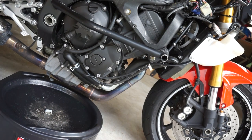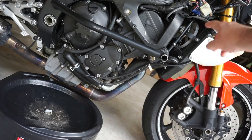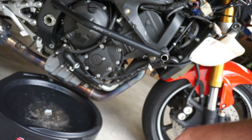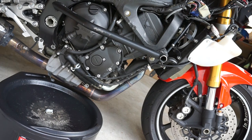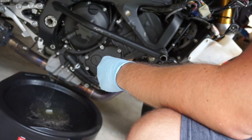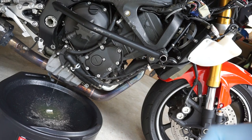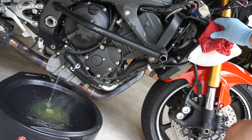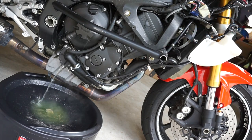At this point we just turned the bike off. Keep in mind you can't unscrew anything right now because everything — the radiator cap and the drain nut — are going to be hot as hell. Let your bike cool off for a minute, then we'll take the screw out and the radiator cap off and let all that distilled water drain through. I've only waited about 10 minutes and this water is still crazy hot — look at the steam coming off of it. I would definitely recommend waiting longer. Grab a towel, unscrew the radiator cap carefully, and get it draining.